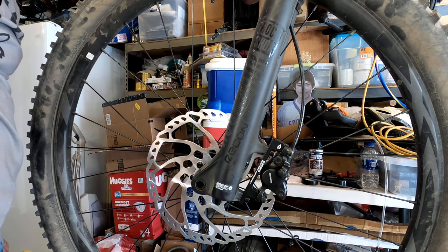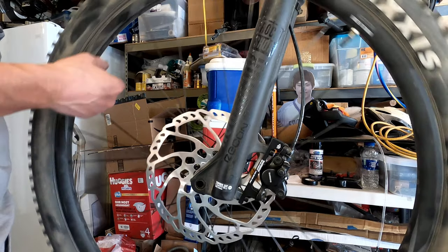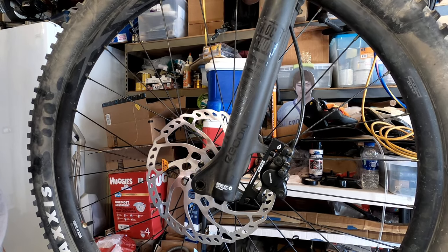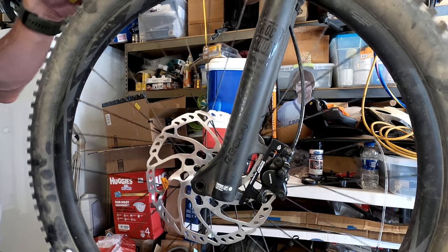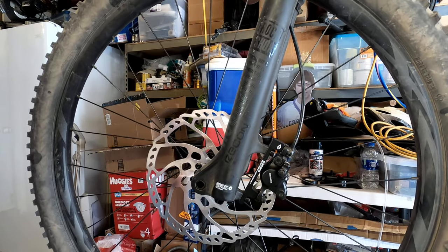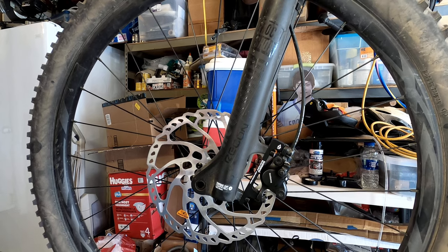So I really wore through those resin brakes in just a matter of a couple months. And I let these things go for probably about 5 months. I was down metal to metal and I scored up the original rotors, and I ended up buying a brand new 180, a brand new 160, because I scored them up along with the brake pads. But I guess I'm riding enough and I'm going through them. Maybe I won't go through as much now with the bigger rotors. I should have more stopping power, so I shouldn't have to be on them as hard. But we'll see.